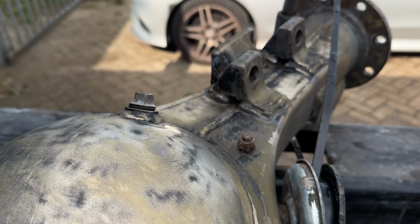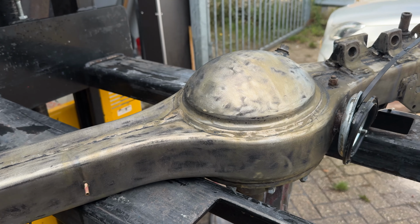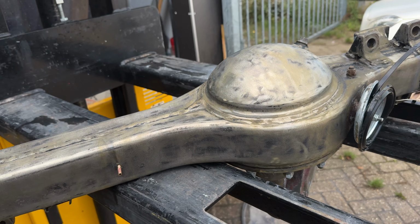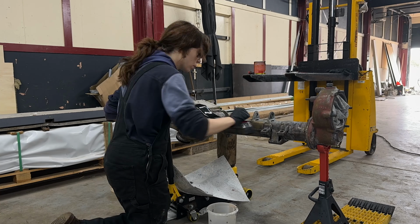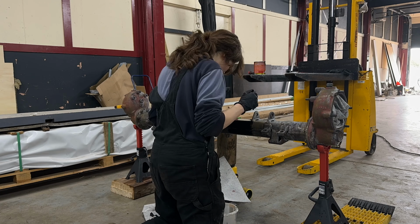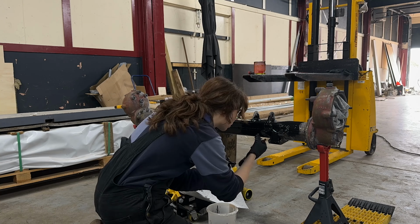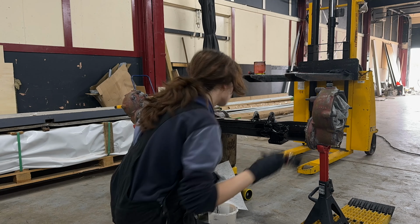This is the other axle that I rinsed thoroughly. Here you can see what it's supposed to look like when you do it properly. I learned from my mistake. After removing the zinc residue, it was time to apply the first layer of rust preventative paint. It's better to do multiple thin layers than just one thick layer. The result will be nicer. I ended up doing 2 layers.